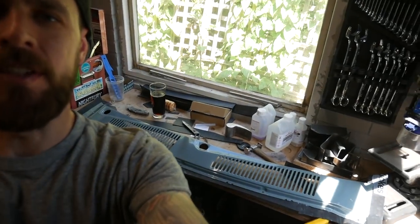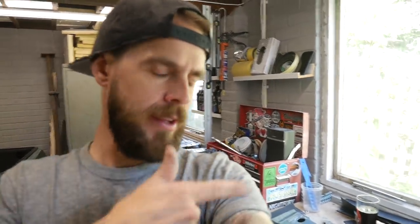As you can see, the release flange is on there. Not too bad. So I'll trim it up, and then I'm going to cover it with the silver tape, and make sure that it's the right size to fit the bag, because it's pretty snug. I don't want to make it too big, obviously, and not be able to get it in the bag once it's all laminated up. So I'll trim that up and then cover it with tape.